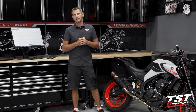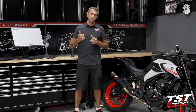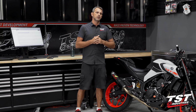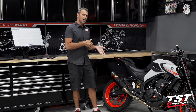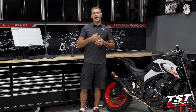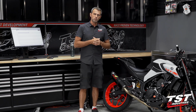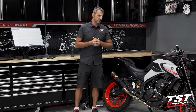I will also be trying in the next trip out, one tooth down in the front, an additional tooth up in the back, making the sprocket 45 tooth in the rear. So we'll see what that does. I did actually notice that at Jennings, I was not geared properly. I was not using 6th gear at all, but I was tacking out 5th gear on the back straight. So I can actually stand to use that shorter gearing and actually make use of that 6th gear.